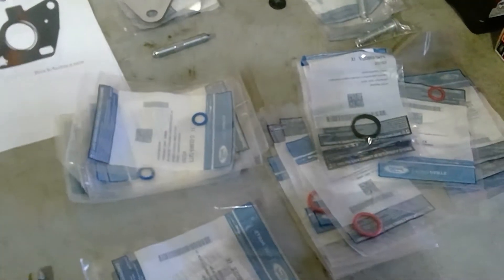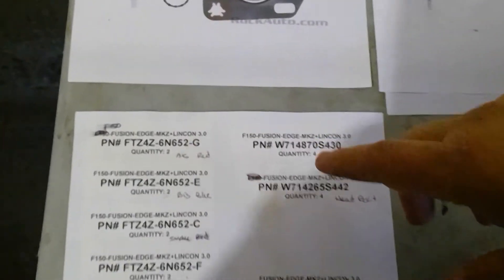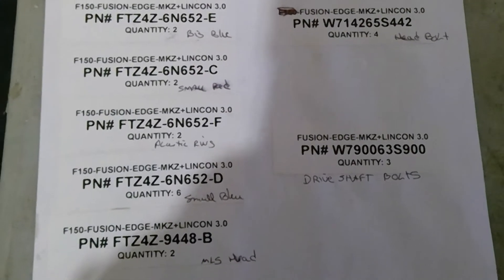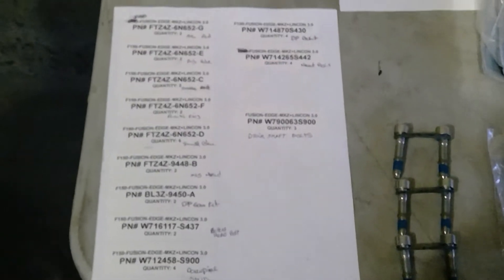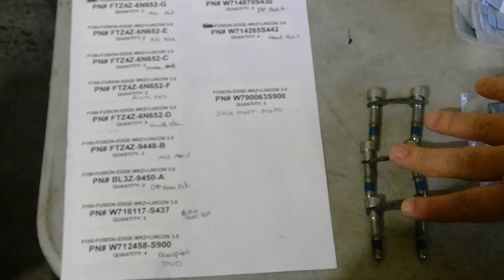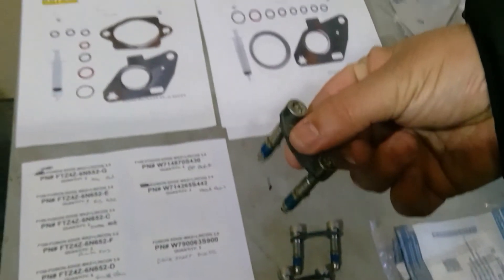On the right, in the middle, and at the table, you could see all the seals and gaskets. I'll focus here for about 10-15 seconds — this is all what you need, the quantity. If you have a CD4 chassis, I strongly recommend changing these, especially if it's the second time you dismantle — you did the downpipes first and now you're doing the turbos. Order these ASAP. These are for the front drive shaft. You need a quantity of three.